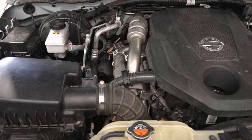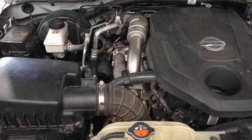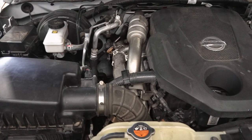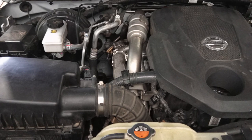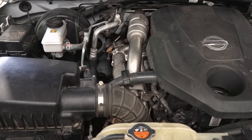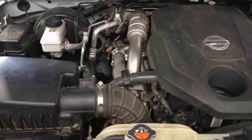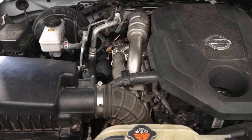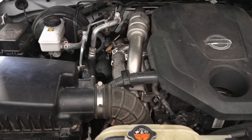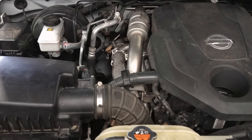This will be an outline of what you need to do. First thing you're going to need to do is get the airbox and air tubes and stuff out of the way. There's a few heat shields that are simple on top. We will start showing you from having the right front wheel removed and the inner guard so that you can gain access in that way. Make sure you watch right through too because there's some stuff we will show you again on reassembly that will make things a bit clearer as well.